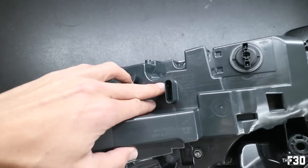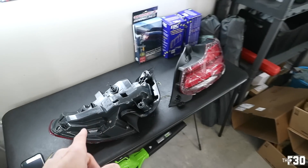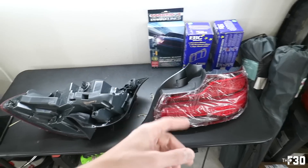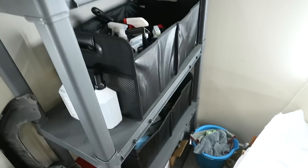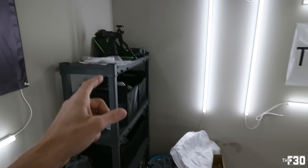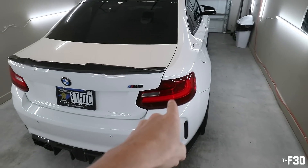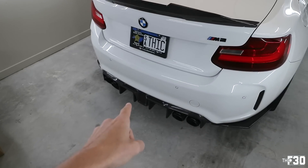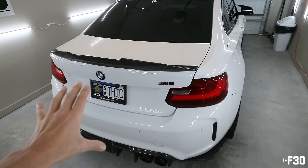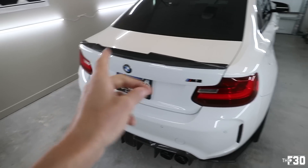The new connector is a six-pin versus the old ones which are an eight-pin, so you have to repin this. I'll leave links below for where I purchased everything, but you can also get this from the dealership, including the new pin connector. Here's the part number for the new plugs. Repinning is really quite simple — you take the pin chart and pin it from eight to six. I also have things spliced in on the right side for my diffuser light, so we'll leave all of that and just repin. Starting with the left side.